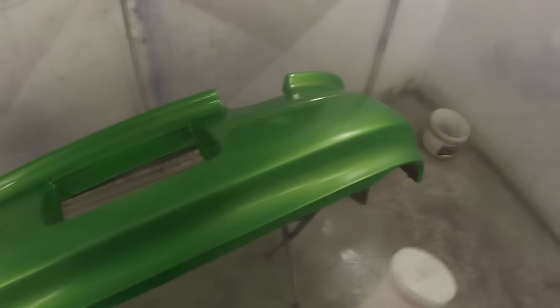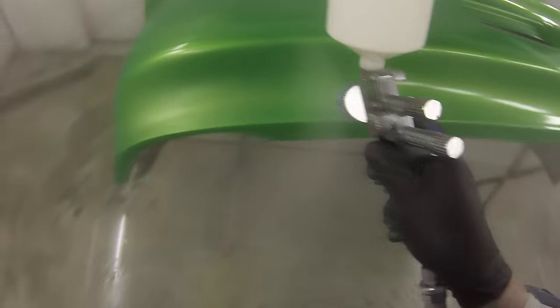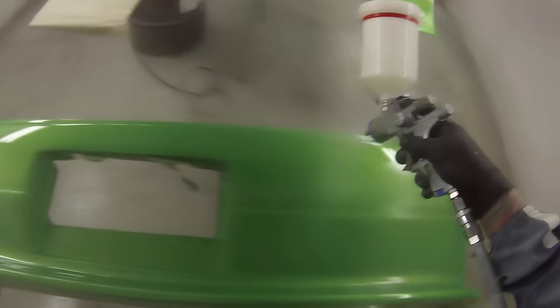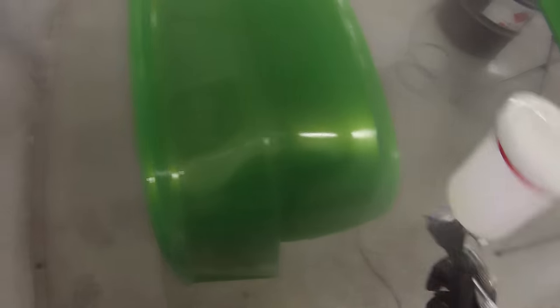If I hadn't heated that clear up I would have had to put reducer in it, and if I'd laid it on that wet there would have been runs all over it. I've been painting for about 14 years — started in 2000 — and it always seems to catch me that first week of cold weather. You continue painting the same way as summer, then winter comes and the paint's not drying as quick. It doesn't take me long to readjust, especially in a spray booth with no heat running on ambient temperature all year round. It really does make a massive difference — I can paint like it's the middle of summer.